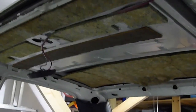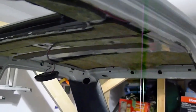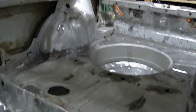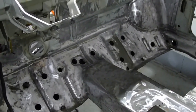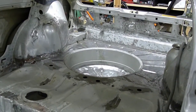The roof line is ready — I'm going to do some bracing up there and build sort of a little hidden roll cage. There are a number of opportunities to stiffen the roof without adding too much weight, stiffen the B-pillar area a little bit, and put some new sheet metal in where the rust is. Also, instead of using tape everywhere — VW used tape in all these little holes in the frame, these access frames — I may actually weld them up.